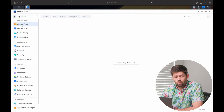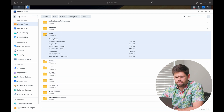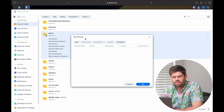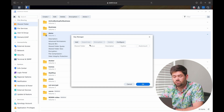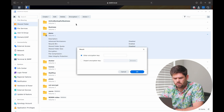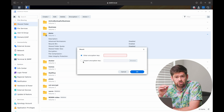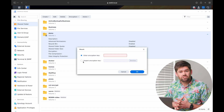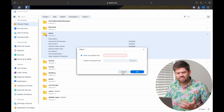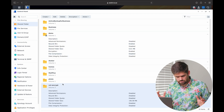Now, what should happen? What should happen is what happened in the shared folder demo. I selected 'mount on boot,' but since I did a soft reset, the encryption key — if we look at the Key Manager — is gone. That Key Manager is just gone. So now if I try to mount this shared folder, I have to enter the encryption key manually. Without that extra knowledge, I cannot access the data in this demo encrypted folder — but I could with the volume encryption.